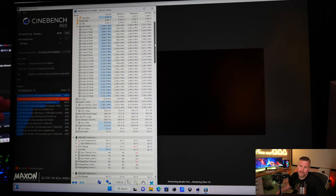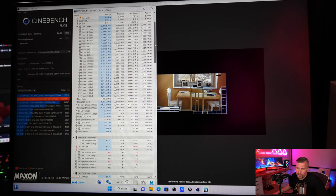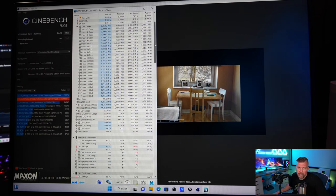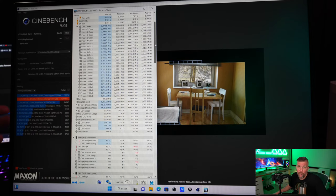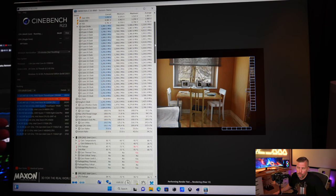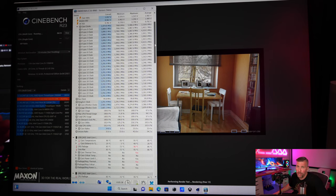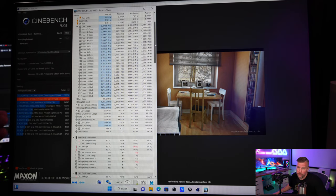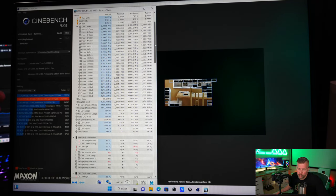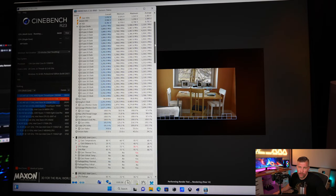Probably very few. I think that's probably the reason. But a more advanced user that's doing undervolting should know how to recover their BIOS if they reset their CMOS if they undervolt too far in a BIOS scenario. Usually if you're doing undervolting in something like Intel XTU or ThrottleStop, it's not a problem because you can always just boot up in safe mode so those don't launch, and then you don't have the undervolt active anymore, and you can just reset the undervolt back to a lower level. So the next time you boot, it doesn't go as low in the undervolt.